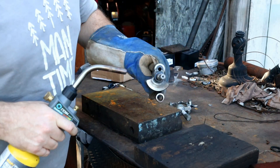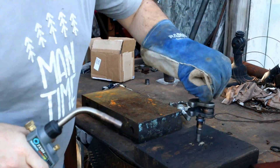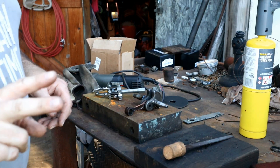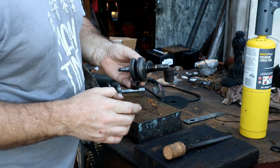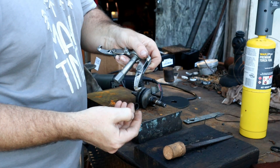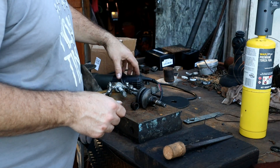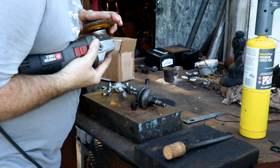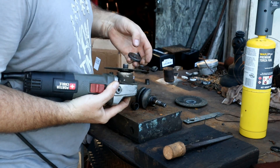Well, it had the O-ring on there. I don't think that's doing it. All right, step two is going to be a two-step process where first we get some flats on this bearing race, and that's going to be with a four-and-a-half inch angle grinder. Then we may actually have to modify the tips of these jaws. We'll come to that when we get there. Let's start with the race — I'm going to switch out to a thinner blade here for a nice tight flat on there.